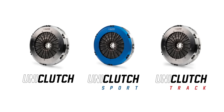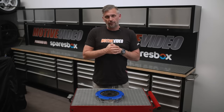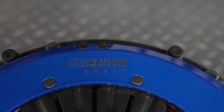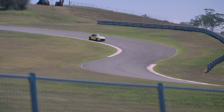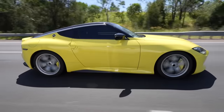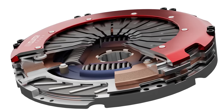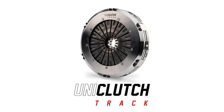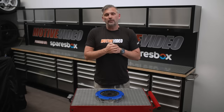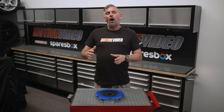There are three different Uni-Clutches in the range. The base one is the OE replacement — it can handle 900 Newton meters and is designed to have better pedal feel than factory. Then you step up to the Sport Uni-Clutch, which we have here with the blue cover. It can handle 1,100 Newton meters of torque and is designed for modified street cars or street cars that do occasional track use, so you can daily drive it and also go to the track on the weekend. Then you step up to the Uni-Clutch Track, which in ICT spec with its ventilated intermediate plate will be able to handle up to 2,000 Newton meters. This clutch is designed for cars that are much more modified with higher power or see a lot more track use. You can still drive it on the street, but with its friction compound designed for track use, it prioritizes torque handling and the ability to handle heat over pedal feel.